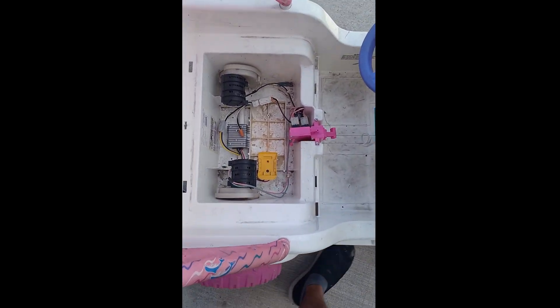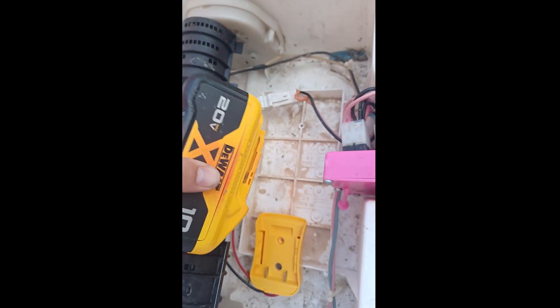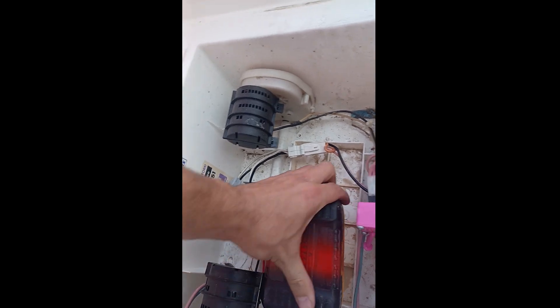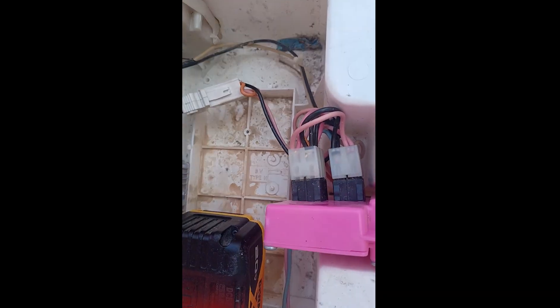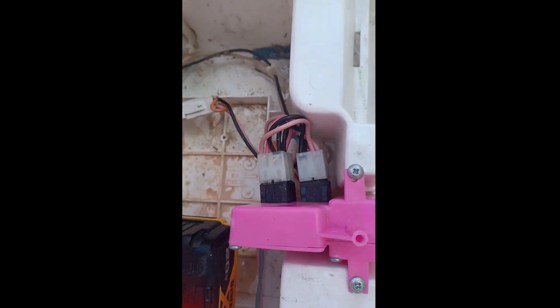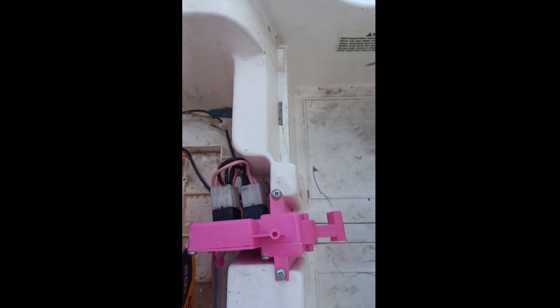Now I've got everything mounted. I've got this 10 amp-hour one — I think this is pretty much as big as it gets size-wise. I know there are also the 60-volt DeWalt batteries; in theory they should work with this adapter just fine as well. We'll slide that in — it does kind of touch the motor housing a bit, but that shouldn't matter. I just wire-nutted the leftover wires together since they aren't doing anything. Essentially the black and white wires go in and loop back around through the orange wire — it's just a closed loop that does nothing, since we're now running off one battery instead of the original two.